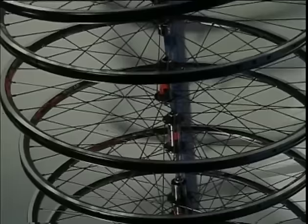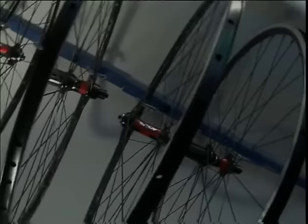The classic number of spokes was 36 for many years. Today, however, with the improvement of wheel components for both mountain bikes and road bikes, 32 is most common. The more spokes used, the more stable the wheel. The higher limit is at 36 spokes. Wheels for track sprinters often use 40 spokes. Tandems, 40 or even 48 spokes.